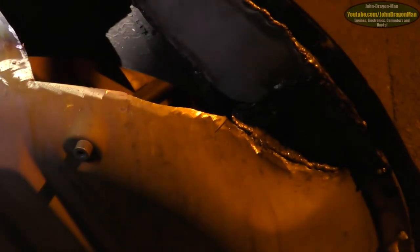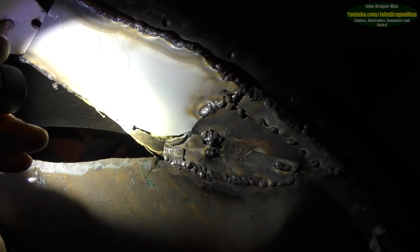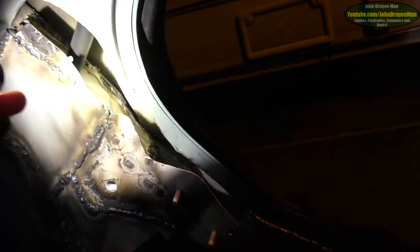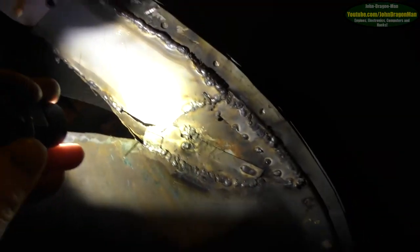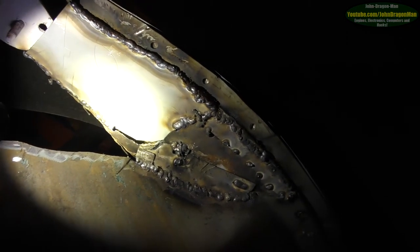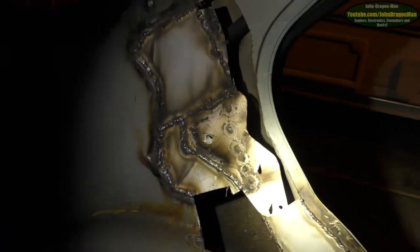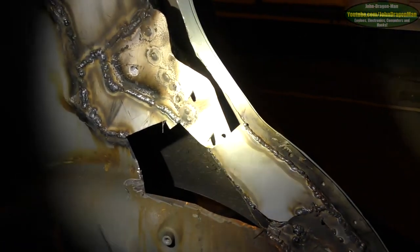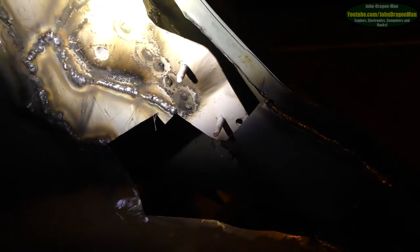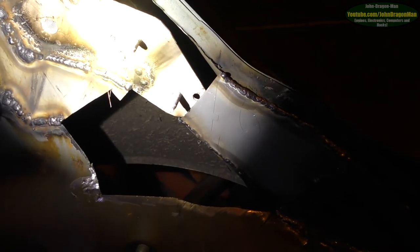There are bits and pieces that I've left out — like this part down here. I've left that strategically so I can dump water in it, because when I do the welding up here I'm going to get a lot of splatter that comes down inside and it's going to rattle down here onto this expanding foam and set fire to it. So strategically I've given myself a little window that I can get in there with the squirty bottle and douse any would-be flames — we don't want those. Happy to report that the seat clips, when it's bolted to that, clip on quite nicely. I've set it on there and closed the seat and it's clipped onto it really well — I'm pretty happy with how I've got that aligned.